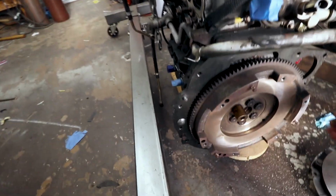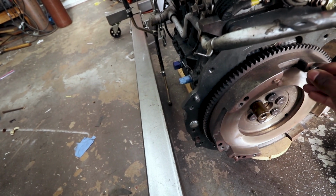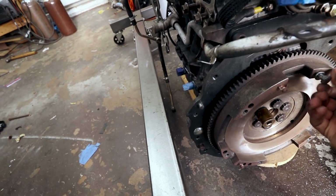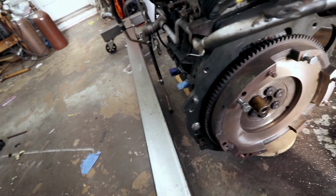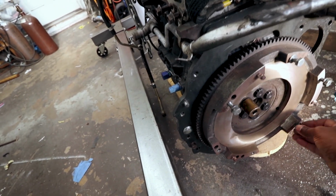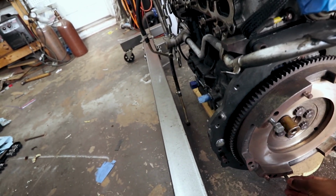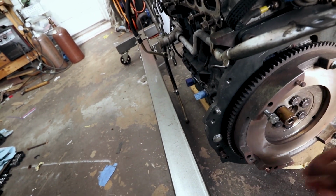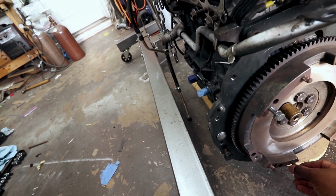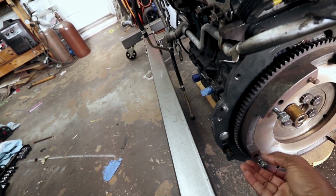We know that one of the issues is clearance. So with the right clutch, you can grind the transmission and you can make it work, right? People also suggest grinding the steps down and just machining the flywheel down. That also works, or a combination of the two.